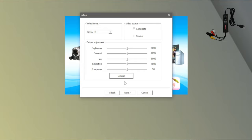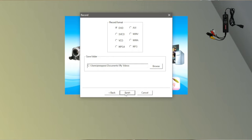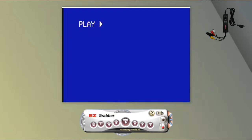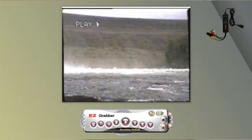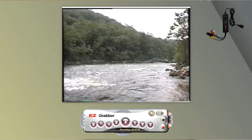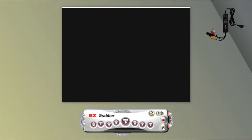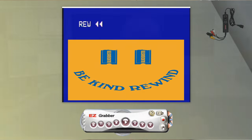Choose the proper video format — in the U.S., it's NTSC Type M. Set the appropriate folders and choose what format you would like to save the videos; in this case, it's DVD. Then click the red button to begin recording and press play on your VCR. We have to watch the entire video as it plays, so go grab a snack or possibly even dinner, because a VHS tape can hold up to eight hours of video in its longest play mode. Once your video is done, click the stop button on the software and you should have a digital version of your tape. Don't forget to stop your VCR and rewind the tape for the next person.